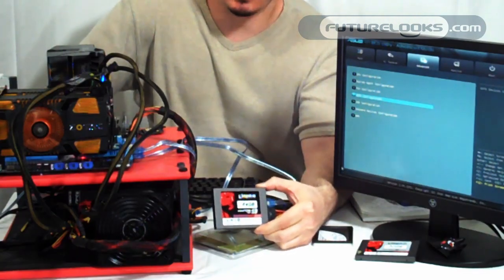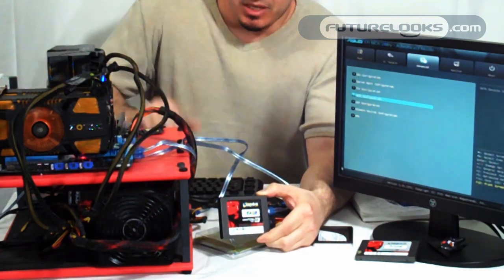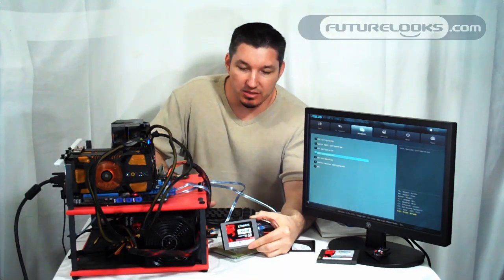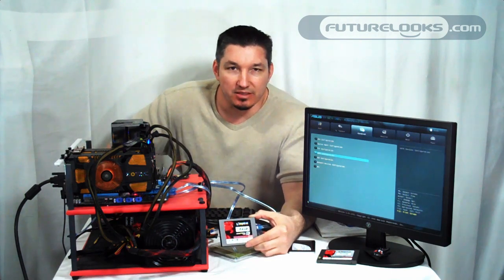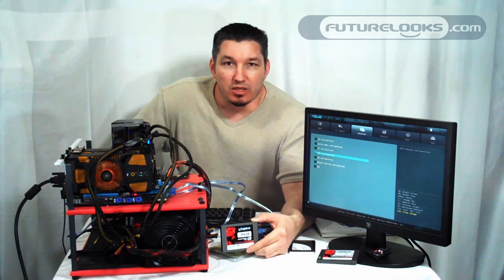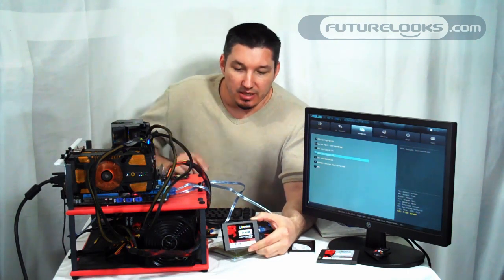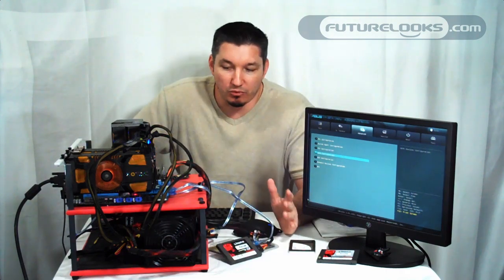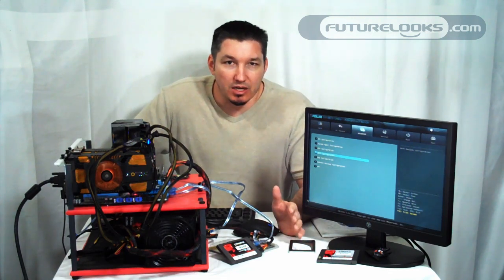Intel Smart Response Technology gives you the ability to connect an SSD to your platter-based system on a Z68 chipset, and what that does is it allows the OS and the entire system to cache a lot of your data to your SSD. For instance, if you're booting your system — which is one of the things a lot of us tend to do, especially here on test benches — the OS is able to cache to this, which improves boot times noticeably and overall improves your system's performance, especially if you're a content creator.